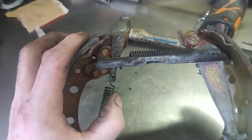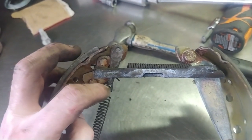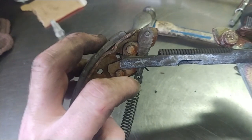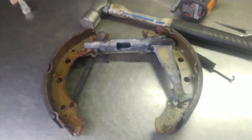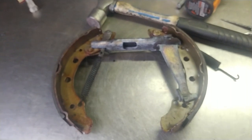In order to get to it, you take one of the lug bolts out, then rotate the wheel until the hole lines up with this little piece here. Then you stick a small pin punch in there and lever it against the drum, pushing the adjuster up — that causes the shoes to retract so you can take the wheel off. I'll show you once it's installed.